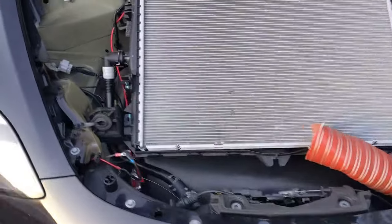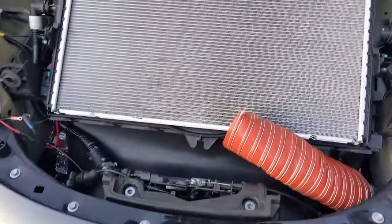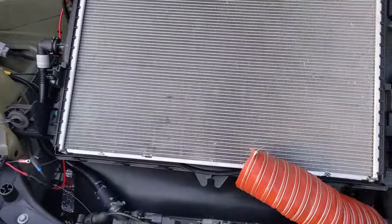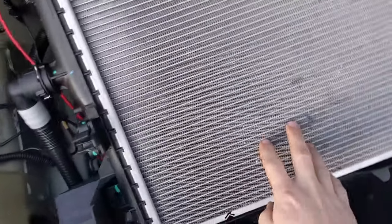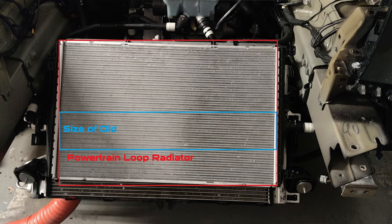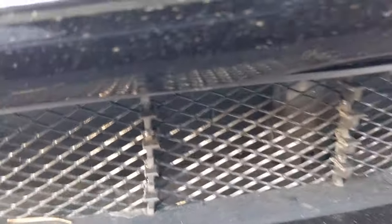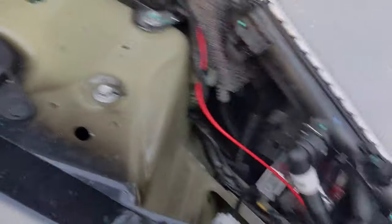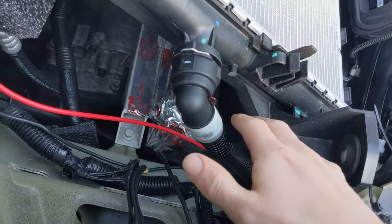So let me show you what we've got. Here's what the front of my Model 3 looks like at this point. As you can see, the frunk is gone — there's no place for it. Behind this radiator here we replaced the factory powertrain loop radiator but maintained the shroud. Air comes in through the front, there are little louvers that are currently closed, but when they're open we have air passing through the new larger radiator for the powertrain loop as well as the AC condenser.